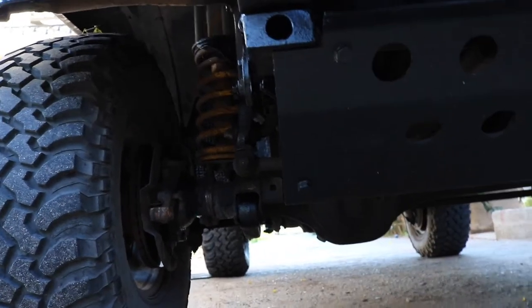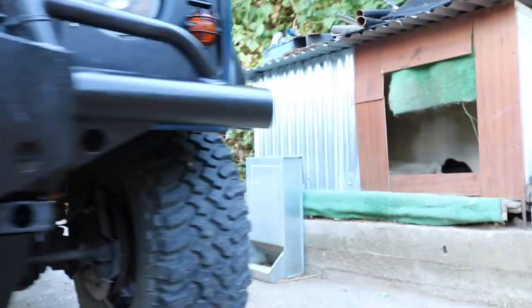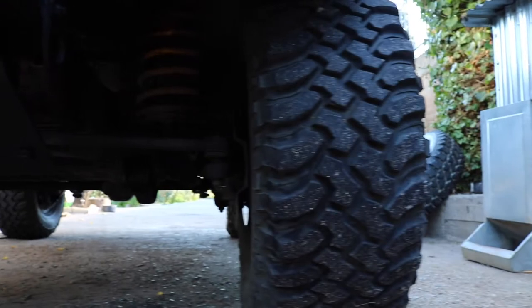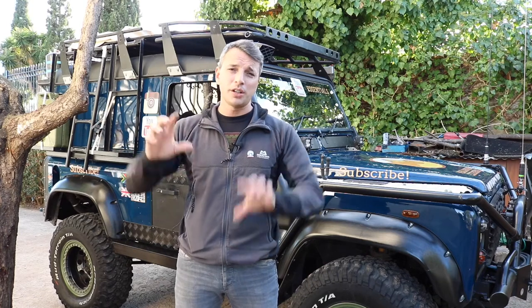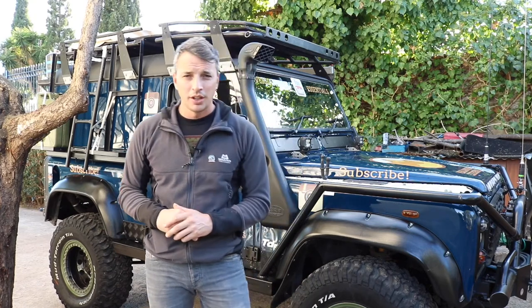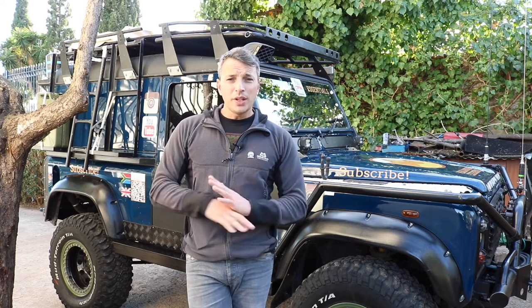While I was there, I did the grease nipples on my UJs and up at the front suspension. While you're laying under there you might as well check your prop shaft UJs as well — just have a quick look at any other bits and pieces, problems you could probably tackle at a later stage.